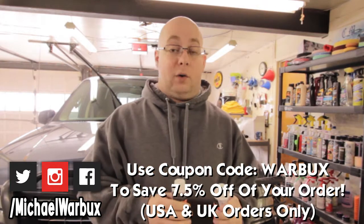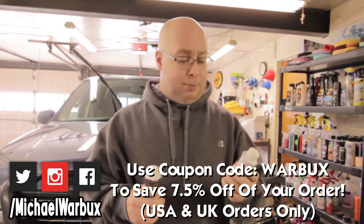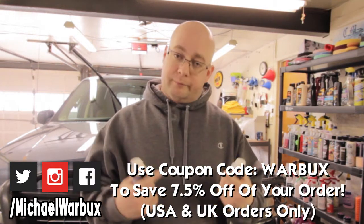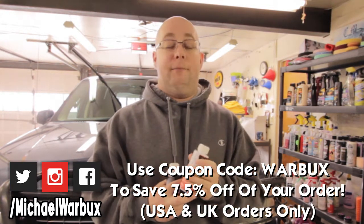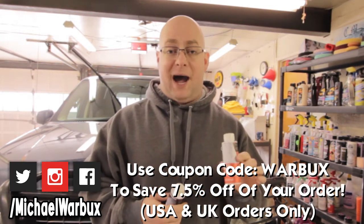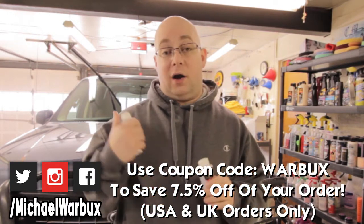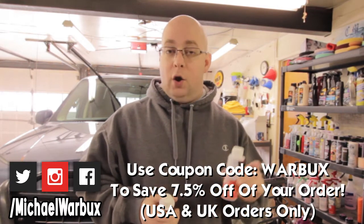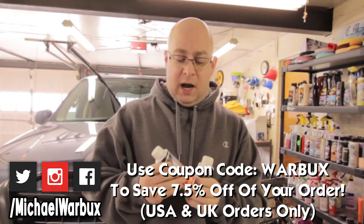Also, if you want to go onto their website, you can see all the instructions on how to use any of these products. So, again, could be my fault. I'll go ahead and accept the blame. But again, for the bazillionth time, the G5, keep in mind, after you let it cure for 15 minutes and you wipe it off, you cannot have water touch your windshield or any of your glass for at least 2 hours, with an overall 24-hour cure time. So hopefully that's what I'll be doing today.